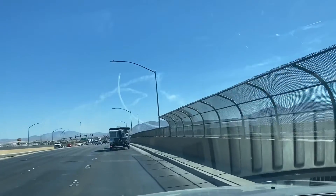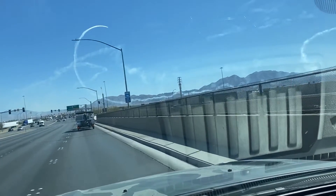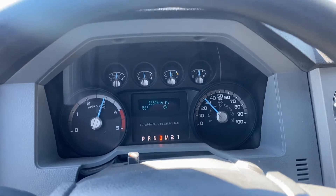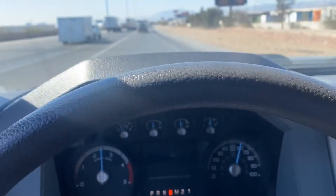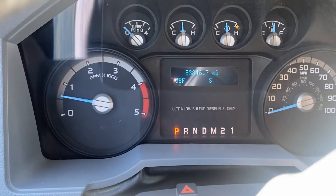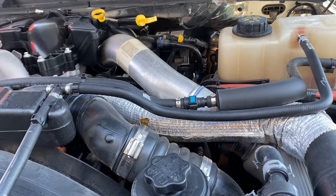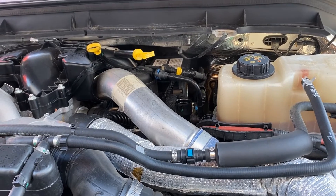These 6.7s really scoot, and I've got a lot of weight behind me. I'm doing hard acceleration to see what's going on. Alright, we've got no pending codes and no codes. We're going to want to see this truck again at about 86,816 miles to do the service again and help alleviate that blow-by, and hopefully have less issues with regeneration and DPF loading. As you can see, the blow-by is substantially a little bit lower — still got some, which is why I told you it's more than one treatment.